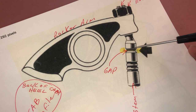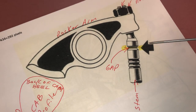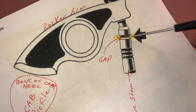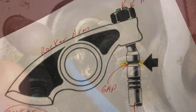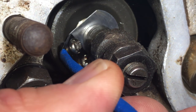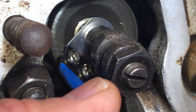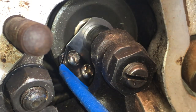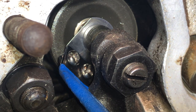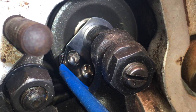It's really got to be right on the money. One thing I've learned about Porsche — they don't really deal in tight tolerances; they deal in exactness. So if they give you a spec, it really needs to be that spec. Looking here, we're on cylinder number three — on top of the valve stem in between our swivel foot — and that's pretty much what it should look and feel like. I've already gone around the engine and checked the other valve lashes, and it looks like our technician was right on the money. Valve lash looks good and cam timing is spot on, which gives me some confidence that the guy working on this engine before actually knew what he was doing and set it up correctly.